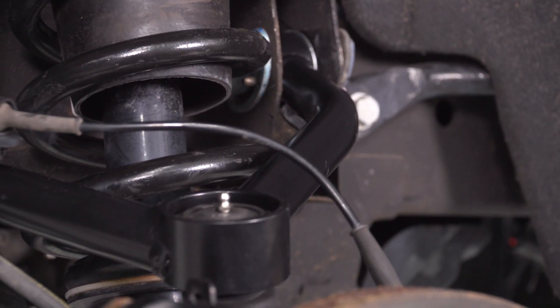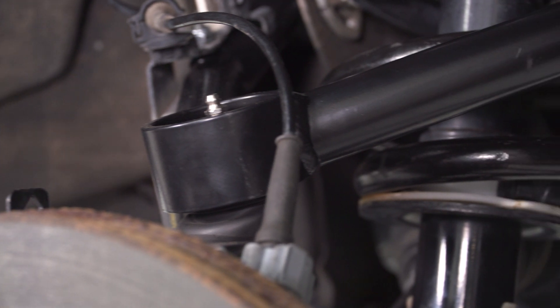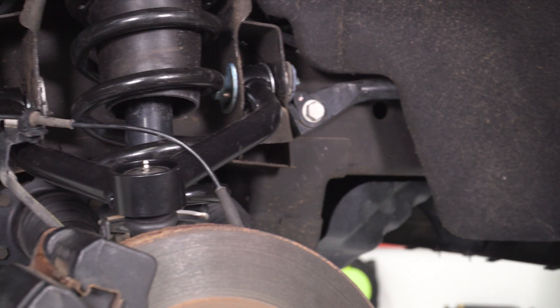This kit is made in the USA from heavy duty DOM tube steel with reinforced joint cups and one ton spring-loaded ball joints. This kit also features ReadyLift's free floating self-lubricating bushings with built-in washers for maintenance-free operation. Coming in at around $420, this is a middle-of-the-road option price-wise, but it's a great addition to your lift or leveling kit to correct your ball joint angle.